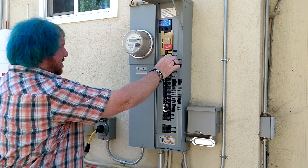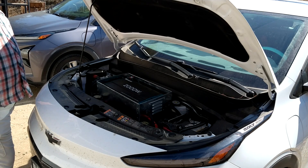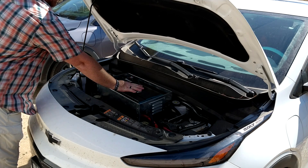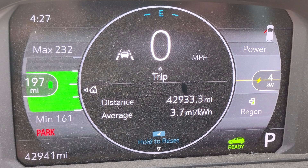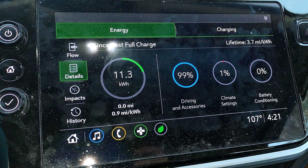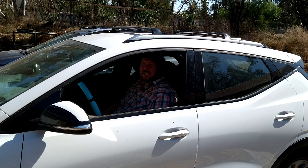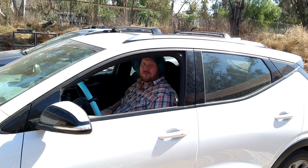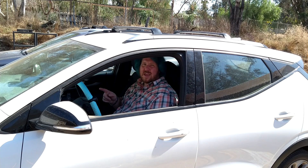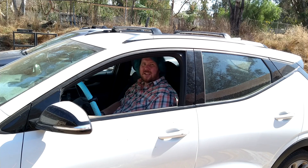That concludes our test. After removing our makeshift cooling, the inverter is warm to the touch, but certainly not hot. Obviously everything survived the test. The car says we used 11.3 kWh. Adding everything up from Emporia View, the house directly consumed 7.7 kWh. That's honestly not terrible efficiency, considering the power has to go from the big battery to the 12-volt battery through the inverter to the house, as well as everything required to keep the car operational — running the cooling pump, cooling fans, battery conditioning if necessary, and things like that.